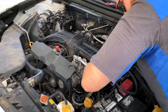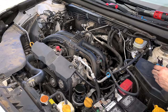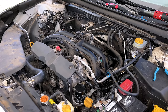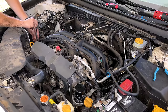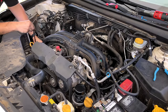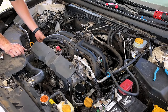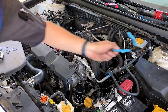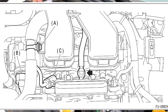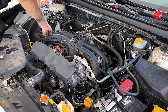There's a little blue lock tab to push over, and once the lock tab's out you can pop the line up. Repeat this on the opposite side of the engine — two 10-millimeter headed fuel rail cover bolts, remove the fuel rail cover, then pop up our fuel line to the rail squeezing in the little blue tabs, flat-head screwdriver in the front, pop it through, lock tab released, pull the line up.